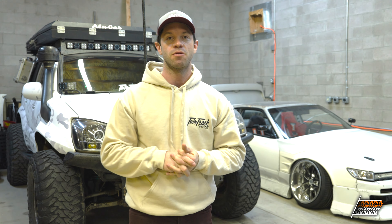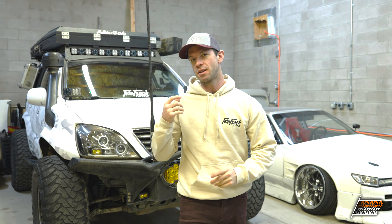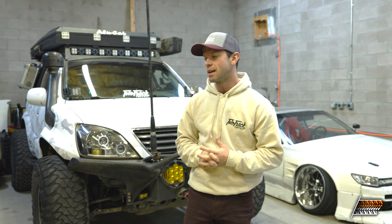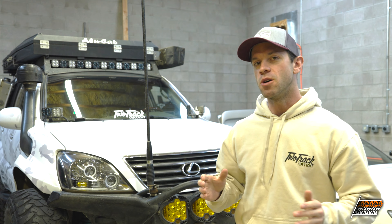That is how you swap engine mounts on a GX 470. It was probably easier because I had the front differential out, but I do think it's definitely possible with the front diff in — you just might have to finagle it a little differently, like flipping it upside down and taking it apart, kind of how I did on the passenger side. Check your engine mounts because they're probably trashed. If you like these videos let me know down below so I can make them better — it's a little hard to film stuff solo. Thanks for checking out the channel, like comment and subscribe.